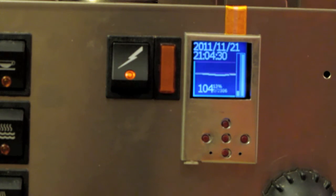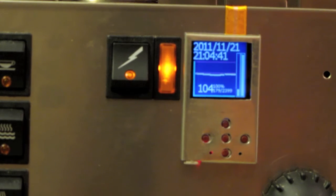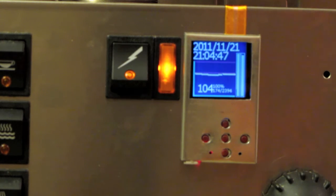At this temperature you could draw your shot. You pull your shot of espresso, and then if you want to steam your milk, you push the up button — that puts it into steam mode. This gives you 100% duty cycle on the heating element for three minutes, and it reads the temperature up to you as it's heating so you'll have an idea when it's ready to go. All of this is configurable too — if the audio bothers you, you can always turn it off. Needless to say, there's a speaker installed in the machine; that's one other thing you'll have to install.